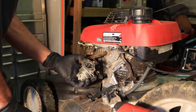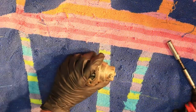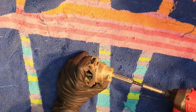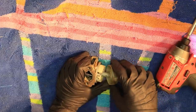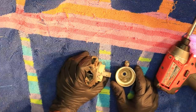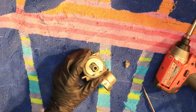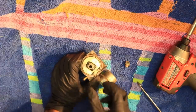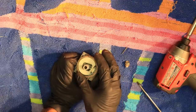I'll reset the cameras and take apart the carburetor and see what we've got. Welcome back — going to take the bowl off and that's going to tell the story, hopefully it's not going to be a sad story. Okay, it doesn't look too bad — that's good. You want to pull that pin out; that one actually comes out with your fingers.